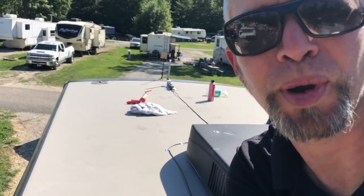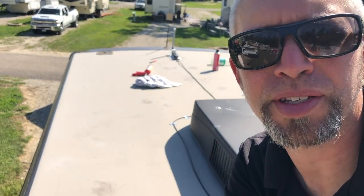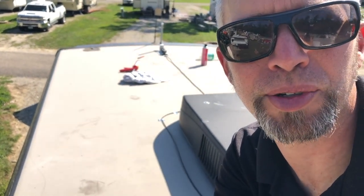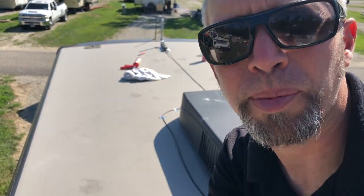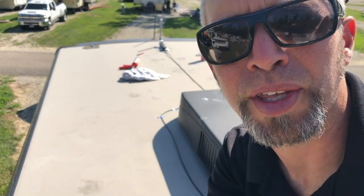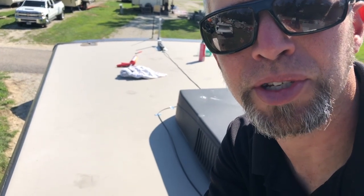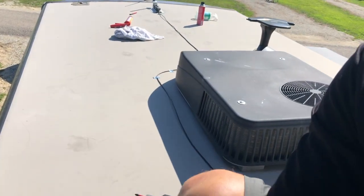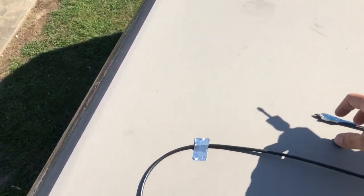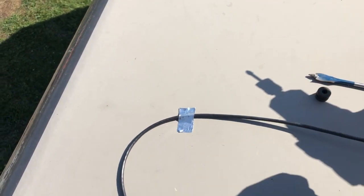I've finished the layout for where I wanted the cord to run. I'll go back with sticky backs, screw them down, and add a little Dicor on the screw heads so the cable won't be flopping around. It'll go over the top of the sticky back with some Dicor as well. Now I'm going to drill a hole through the roof, install the grommet, and put some Dicor over the top of it.